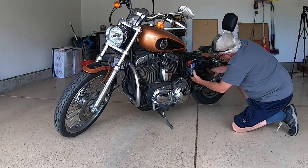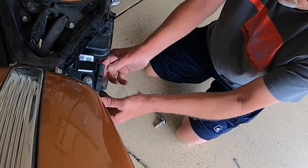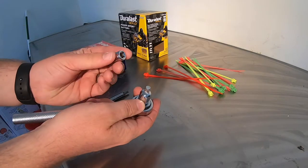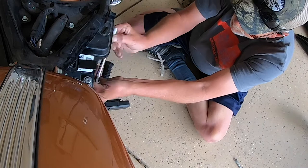Next, remove the battery cover. Right after you do, you'll see this fuse box right here — just push it to the back and pull it right off. Now reach for your 10mm ratchet. You'll need it to remove this strap; it's only connected by this nut at the bottom of the battery, and it can be really easy to get off with the right tool.